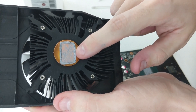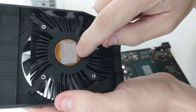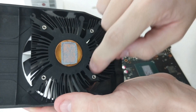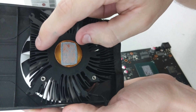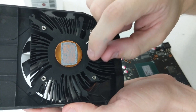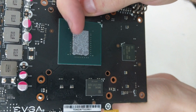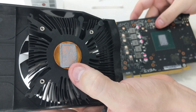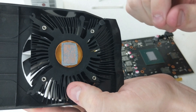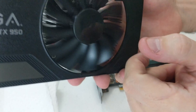What you want to do is put something thermally conductive in between the two so it can fill all the little cracks and crevices and allow heat to transfer from the GPU die up to the heat sink. Copper is more thermally conductive than aluminum but also considerably more expensive, so manufacturers often put a copper plug in the middle connected to aluminum. The aluminum is responsible for getting the heat away, and the copper plug gets the heat from the GPU die. The heat goes from the die into the copper plug, the plug radiates to the aluminum, and the fans take the heat off the aluminum out into the case.